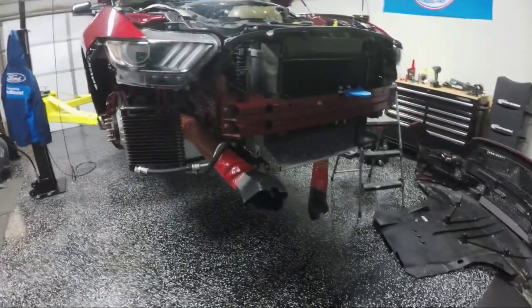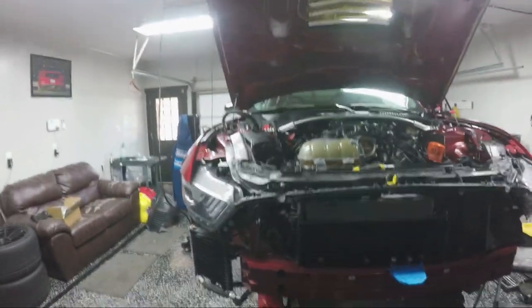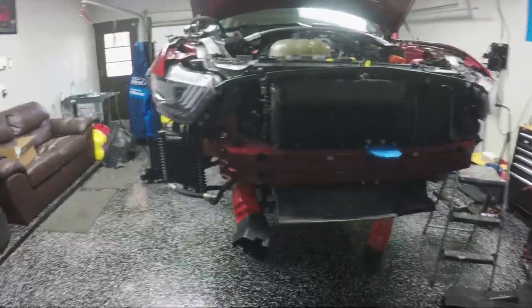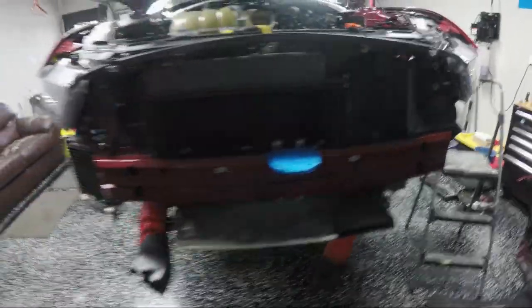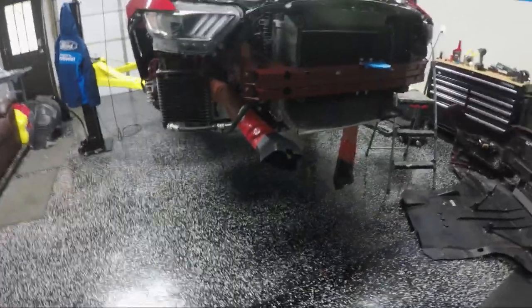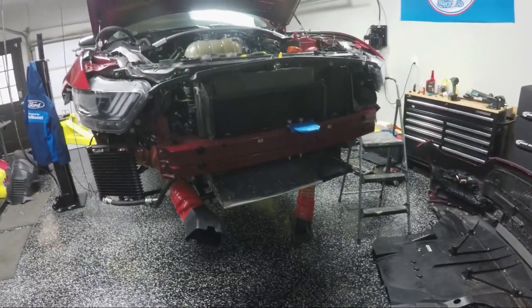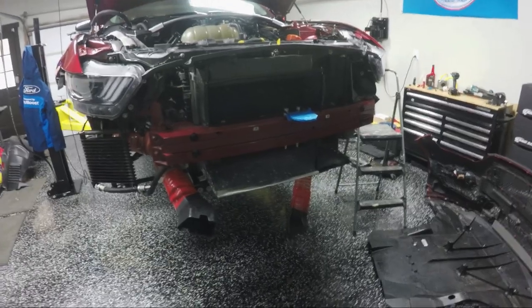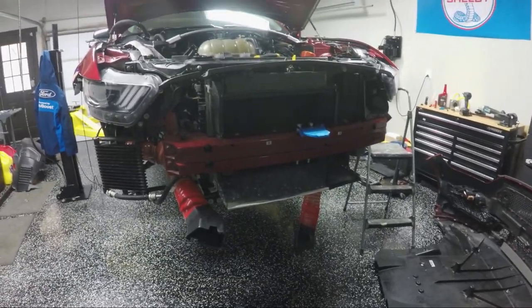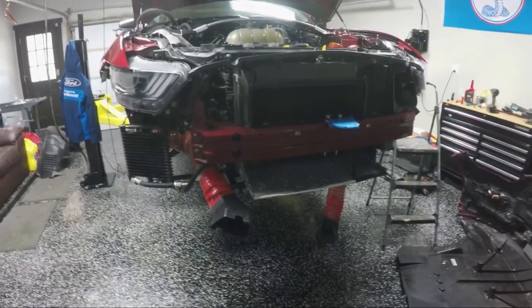Kevin here with the Honey Badger. Today we're going to make some changes and redo some things based on experiences I've had on track. First, the oil breather can up there — the Peterson breather I use to vent crankcase pressure. I'm going to change the hoses on that; it's using really crappy rubber hoses that were coming off on me. I'll upgrade those to AN hose. We're also going to make some modifications to the front ductwork because that kind of failed on me, and then redo the plumbing for the remote oil filter.